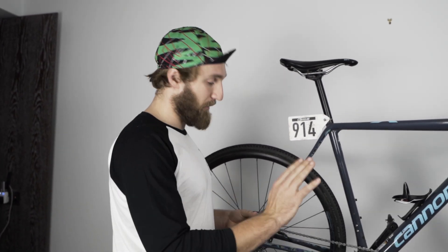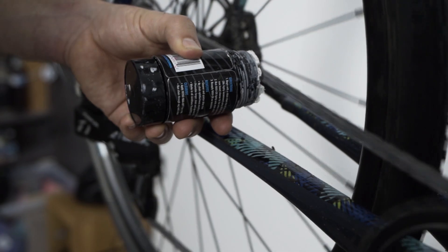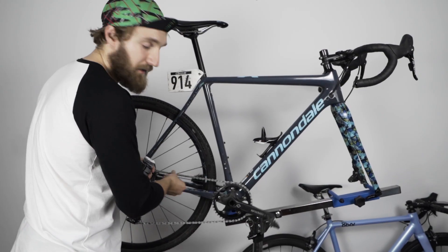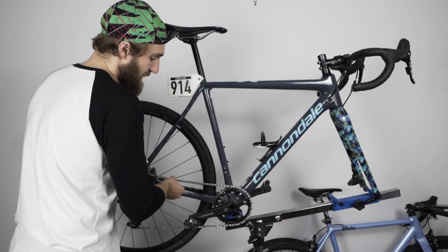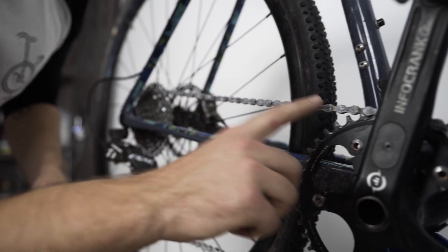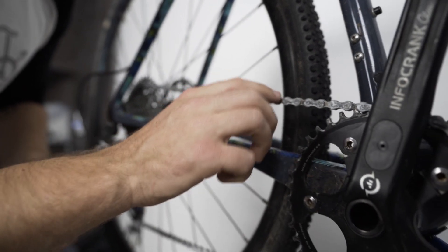The next stage is applying wax to the outside of each part of the chain. If you've got the coloured stick it's going to make it look really good, but also all the wax that spills over from the outside basically seals all the edges when we melt it later — that's really quite important. So we just let it run over the outside as well. You don't have to be really thick, but a little coating on the outside becomes quite useful. I'm rubbing it all in to completely coat the chain from all angles. The reason we've done the outside plates is because everything falling over onto the lips here is all really useful to have in place. If you haven't done the outside of the chain you might not get everything covered on the rollers, so I like to do the whole way around just to be diligent.